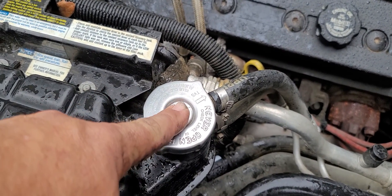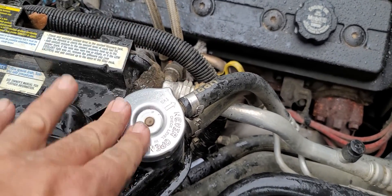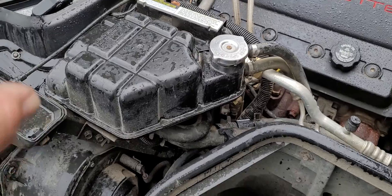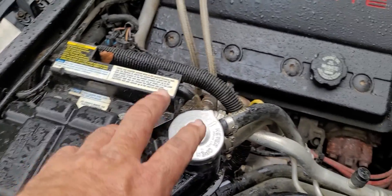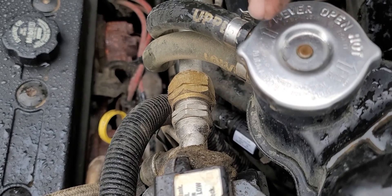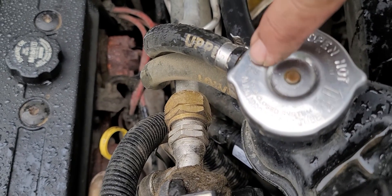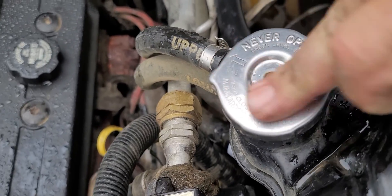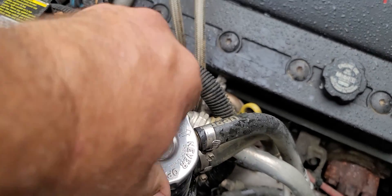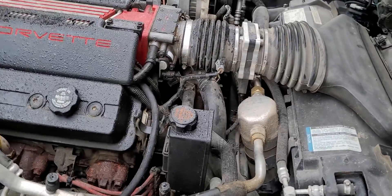What happens is the wax pellet inside the cap gets old over the years. Once it wears down, it won't release the spring pressure like it's supposed to - it won't heat up and release - and that can damage the system. The good news is a lot of these parts are fairly easy to get. The tank is sold brand new, and these caps are sold new too. For you guys who like factory-original details: 1994 through 1996 caps say 'TvS' on them, and the earlier cars say 'AC Delco.' When I bought this car it had the wrong cap on it, so I had to get the correct one off a parts car.